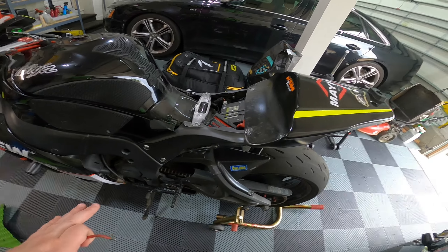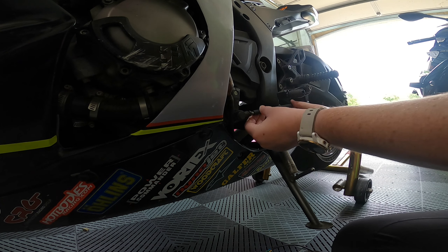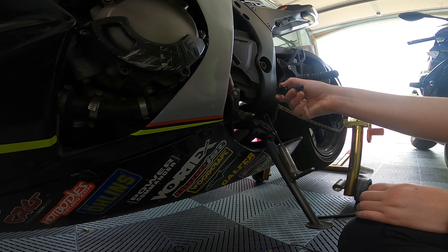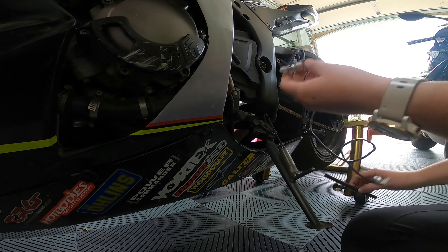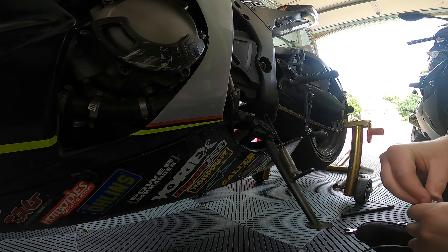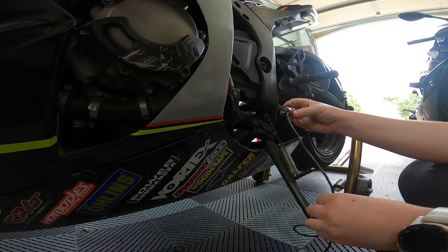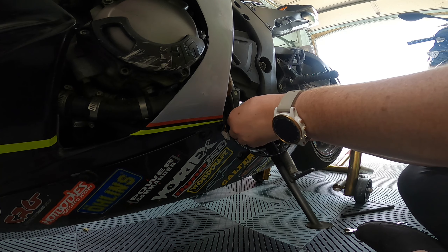Next up, I'm going to get started on the actual shift rod. So I got my shift rod off here — there's a bunch of garbage in it. I'm not a stickler for shift rod position. If you were, the best way to do it is to measure this exact length and then make sure that whatever you were doing with the sensor was the exact same length. I needed to adjust mine anyway, so I'm not going to mess around with that today. Basically this is only going to fit in one spot, so we're going to end up going right here. I'm going to thread that on. It'd be way easier if I had taken the heim joint off, but it is what it is.